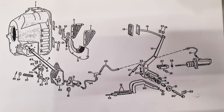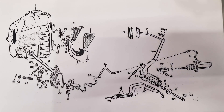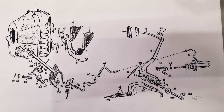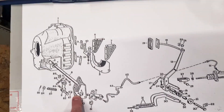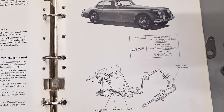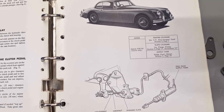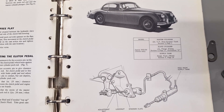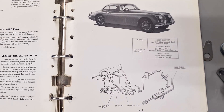As you may know, on the XK150 Jaguar went over to a Girling hydraulic clutch system. This solved some problems but of course has a few of its own. The early design of clutch slave bracket, as you can see here in this Girling dealer service book, was a bracket with just two supports on it. This allowed for flex in the mechanism, so to improve on this method Jaguar designed a new mounting bracket.